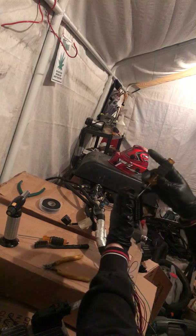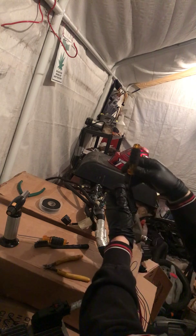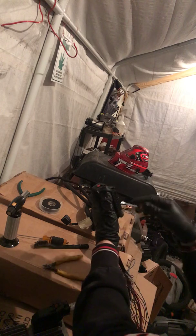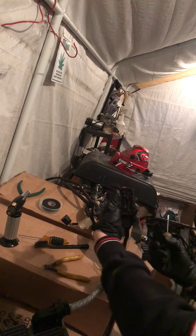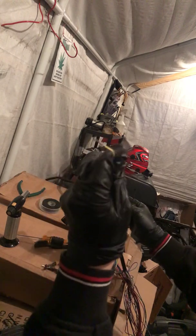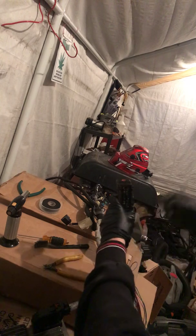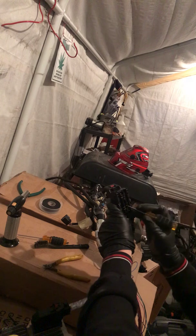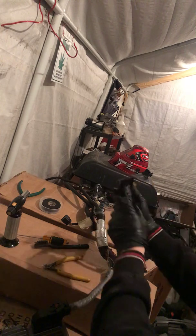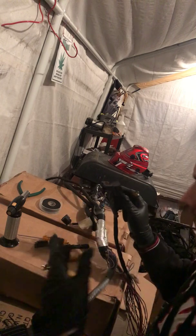With this connector right here, using a small pin screwdriver you just pry it upwards. Once you have all the wires exposed, note the orientation of the pins that we're removing — they all go in a certain way, and you can find this list in the description link. You just fold the little plastic tab and pull the wire up out of there, then make sure you fill the cavity with some silicone or RTV so you don't run into corrosion problems in the future.